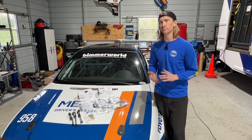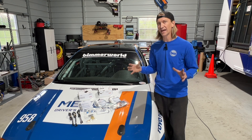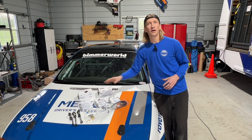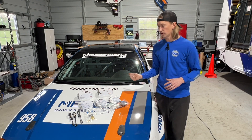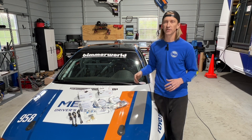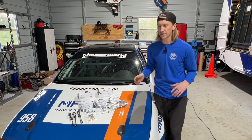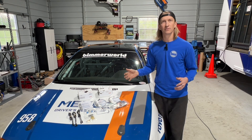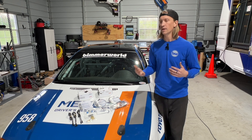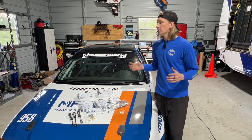This capability was previously only reserved for the full dash line of AiM stuff, so it's pretty awesome to now be able to add on external sensors. The analog CAN converter allows you to add four sensors to the Solo 2 DL. Today I'm going to add brake pressure, fuel pressure, and oil pressure. Oil pressure is good to know the health of the engine. Fuel pressure is good for diagnostics. Brake pressure is great as a driving tool - for example, to compare how James is applying the brakes versus how I'm applying them.